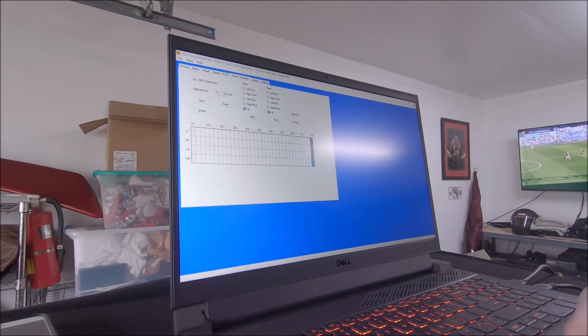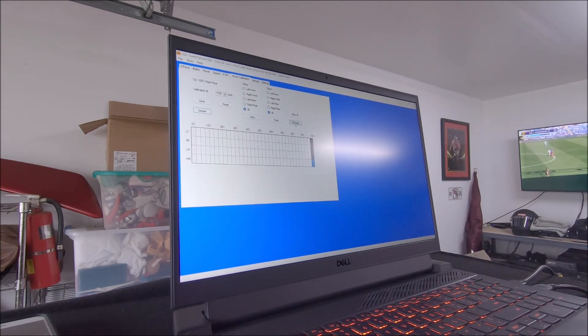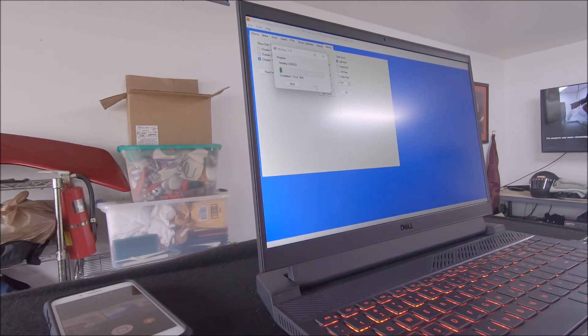Update the rear values, and since we have zero and the hundred filled in, we do Fill Empty — yes, confirm — and it fills in the chart in a linear fashion from zero percent to 100 percent. It's not very quick to do if you're just making a shock change, but that's the process. Then Write All > Begin, let it go all the way to 100, save this file to Ron's copy, and it's done.